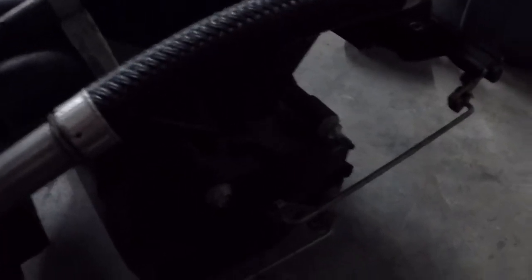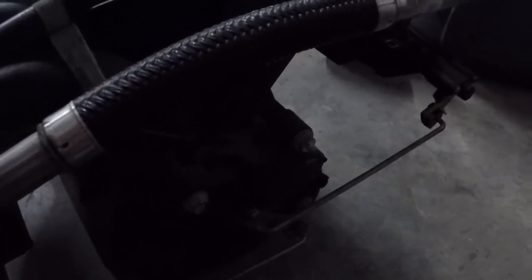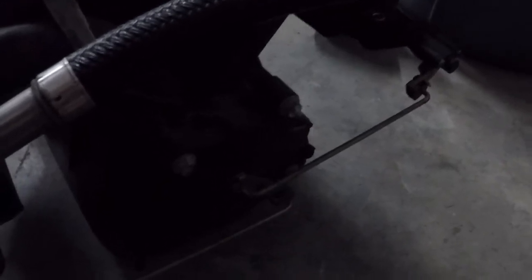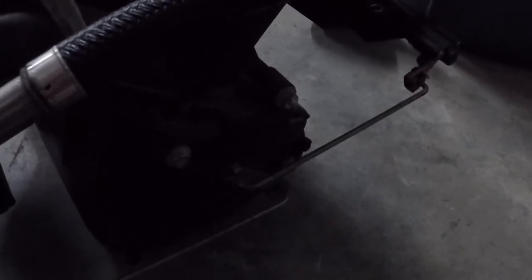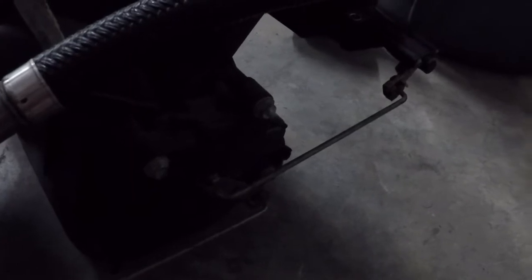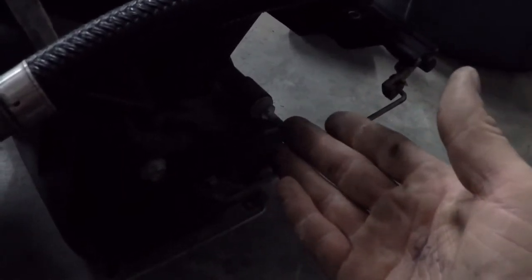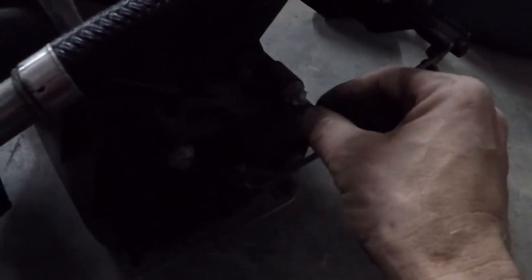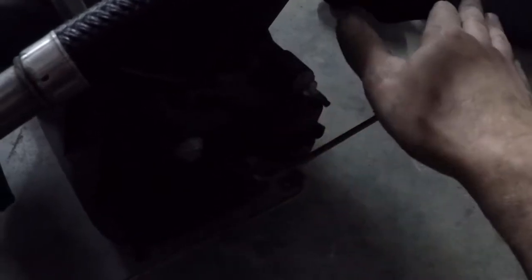There's enough room to run the wires underneath — I'm not sure why they designed it that way, but they just did. One telltale sign that the intake has been off the vehicle before is if the nut is missing off the stud that holds the wiring harness. I try my best to put that nut back on, but it doesn't happen a hundred percent of the time. Granted, it won't hurt anything or affect performance if the wiring harness isn't secured there, because most of the time it rests on top where it won't interfere with anything.